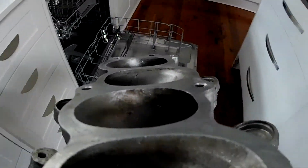Just cleaning up these ports - there's not only just the general roughness of the casting, but there's a seam in the mould that these were poured into on the sides that's quite significant and needs to be removed. That's in every port, so I'm just paying a little bit of extra attention to those, getting them all smooth and nice and cleaned up.